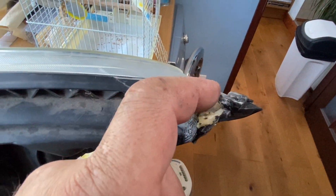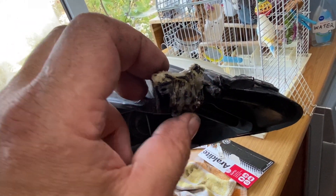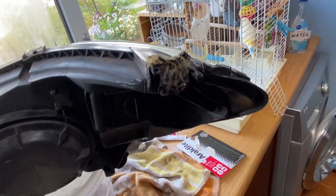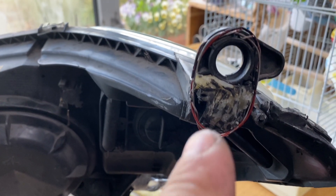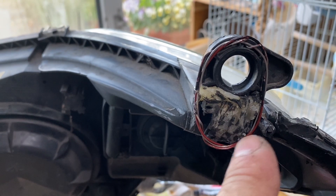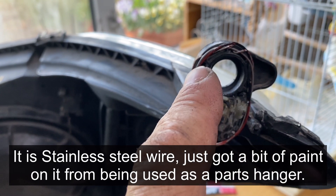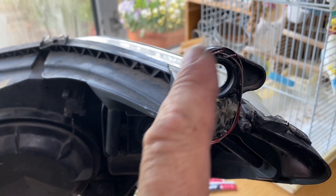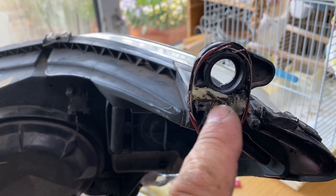So I've done some cross-hatching here and here. I've cleaned all this away and there's little lumpy bits that I can get all the stuff into. Now I'm just going to glue that top piece on and then cover it around with everything. I'm just going to have this bit of wire that goes around there, and then the epoxy — I'm going to very carefully feather it in there and all around, and it'll just give a real mechanical link to the plastic, because that's where the join is across there.